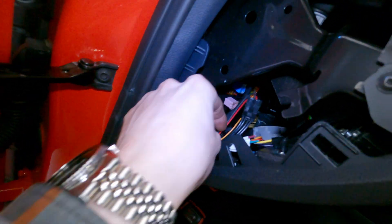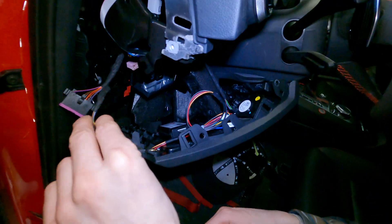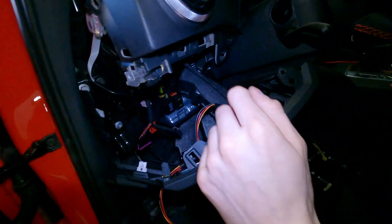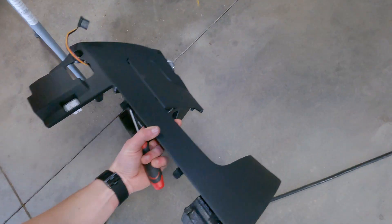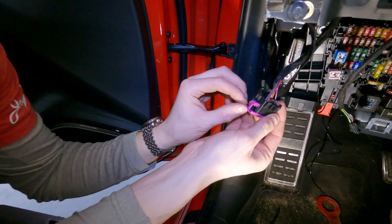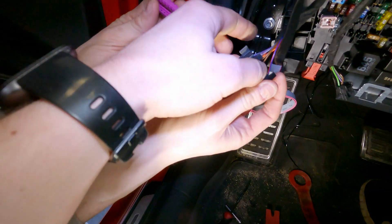Not a whole lot of slack here, but you'll be able to finesse out the pin we need. So we pulled the whole kick plate — there were two 8mm underneath, one over here and then one by the tunnel, and then a T20 Torx right here. And then the rest of the top are just like slip joint pressure fits, so we used a trim tool to pop a few of them out of the way. With this OBD2 lock, you can get your pick in here — it's just a little snap pressure snap. Get that in there just enough to kind of wrench this out to the side, and then the whole thing just slides right out.